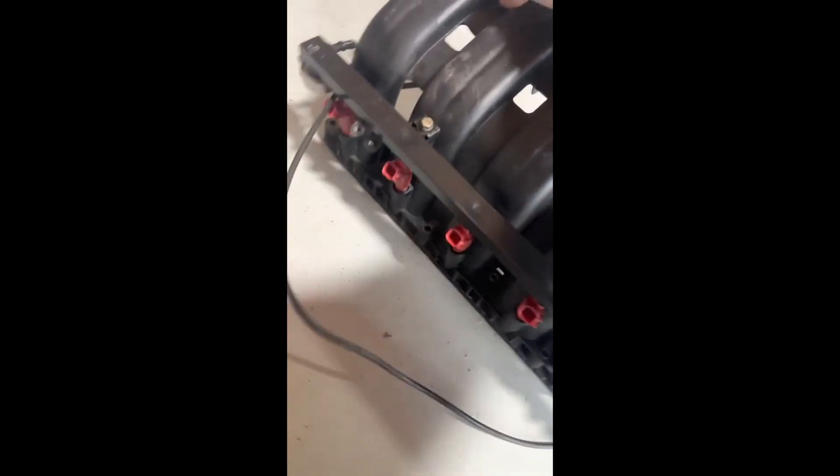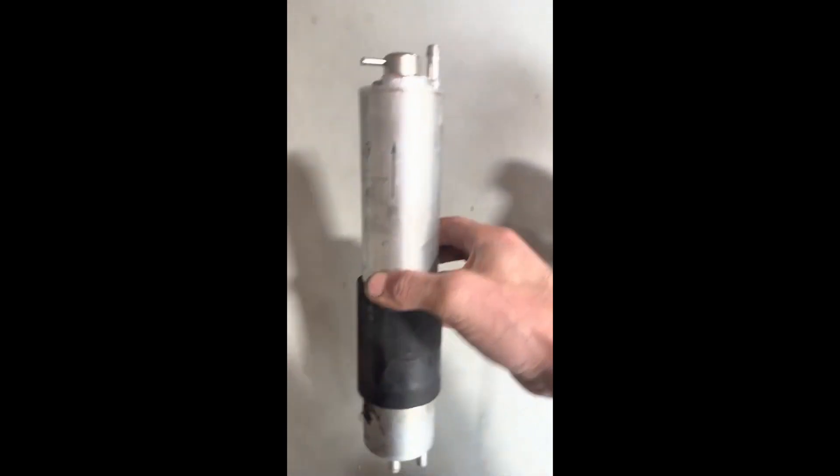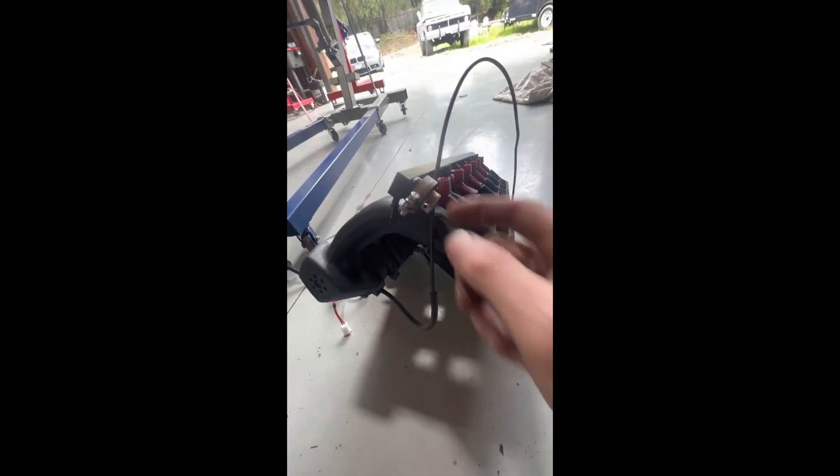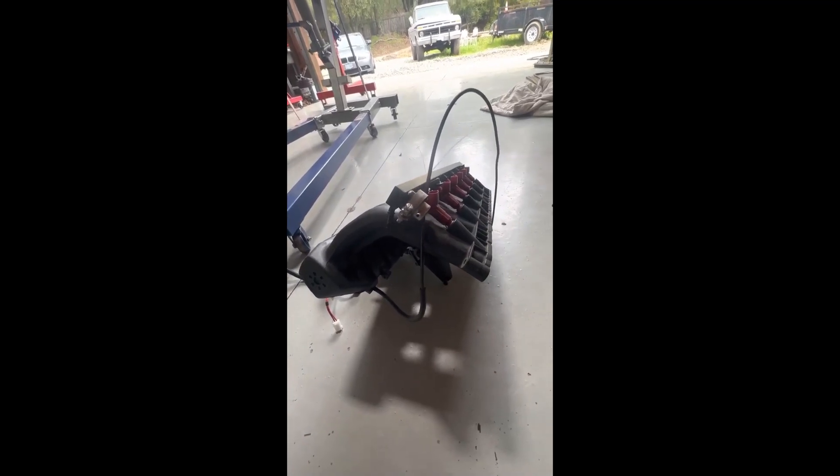I used the stock M50 temp sensor and rescaled it in the tuning. I went a slightly different route from the last video — originally I had that blocked off, but the stock fuel filter on the M54 has a built-in regulator and just sends a regulated supply to the fuel rail. On the M50 rail it has a feed and return, so I used the M50 fuel filter and extended the line to have a return and a feed. It'll just be regulated off the stock pressure regulator on the rail, and this doesn't even get a vacuum reference — these cars run at full reference.